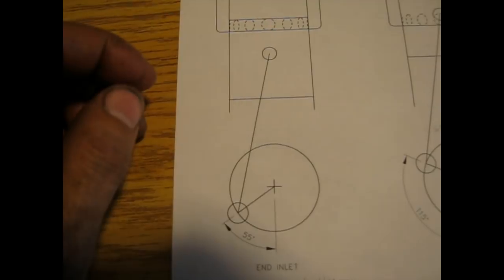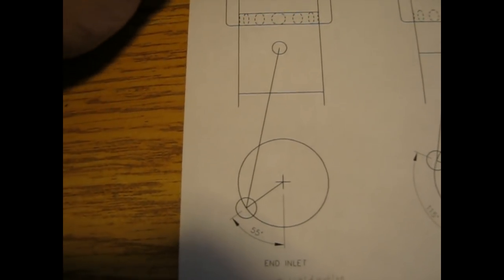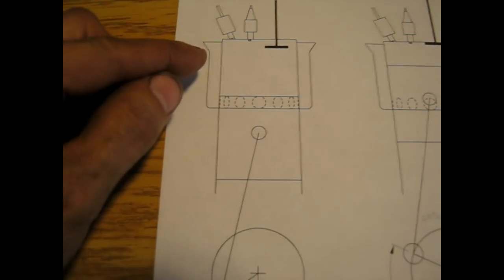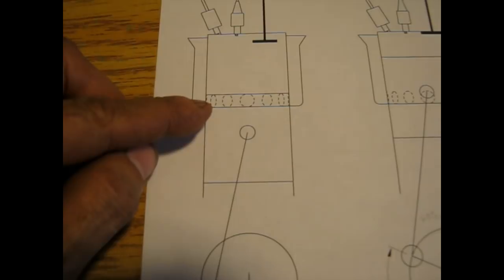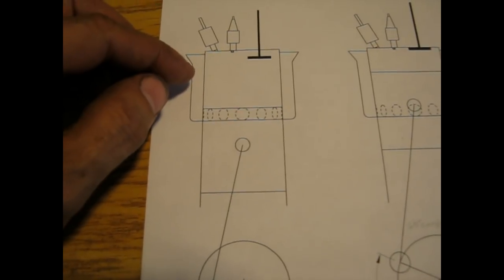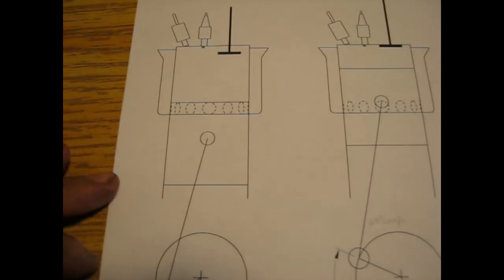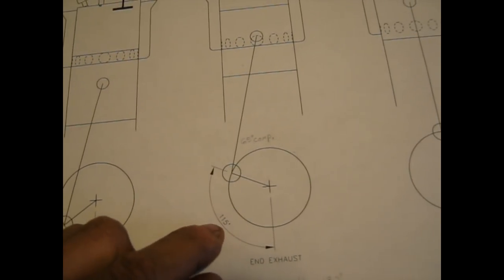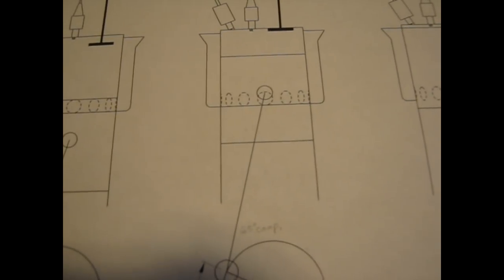In that meantime the air has been sucked into the cylinder and some exhaust has gone out the top of the cylinder. Now the piston is moving upward and it's pushing the exhaust out. Because the inlet air came in at the bottom, the exhaust gases would be more or less at the top of the cylinder. There's probably some mixing of the two, but they will be up at the top end and getting pushed out.